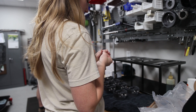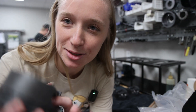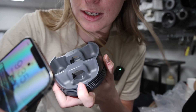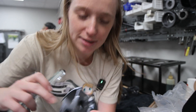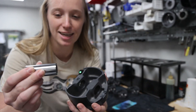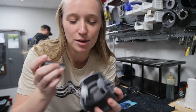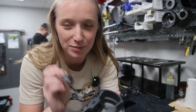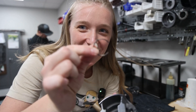Now I've got to take one of these locks and put them on the side that we just put the number on. We're going to put these little locks in — they have a little notch right in there, and that's where we're going to inset the little locking ring in there which holds these wrist pins. Once you get one of these locking rings set in that little notch, we're going to put these through just to make sure it's in there, but actually fitting one of these guys inside is really difficult because it'll pop out at you — just like springs on a car, they have lots of tension and they're really strong metal.